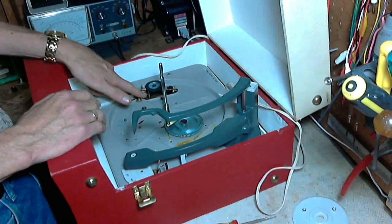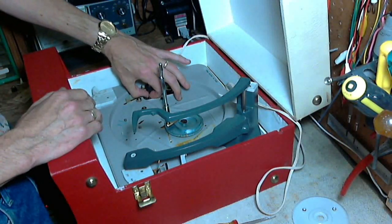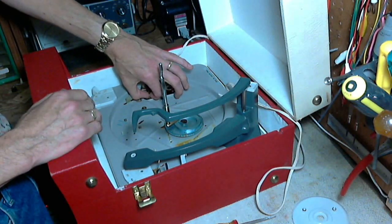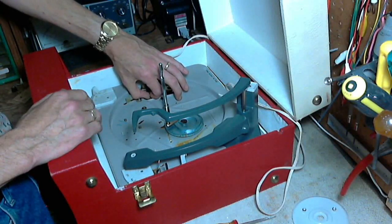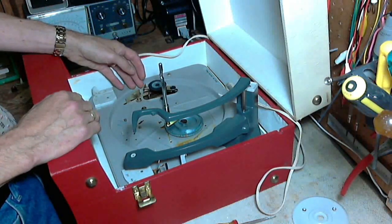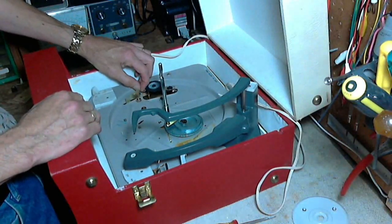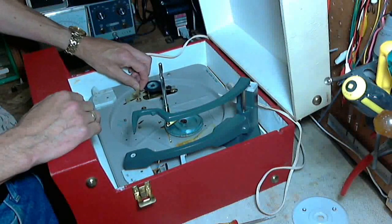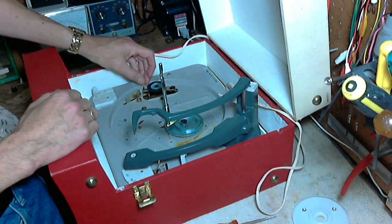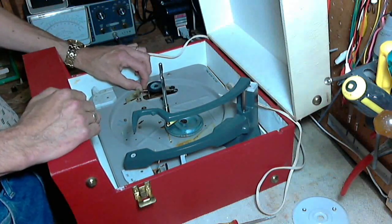I'm going to turn it back on and watch the motor, squeeze it a bit to slow it. You know what, it turns really nicely — it's not even worth testing, it turns really nicely. I don't think there's a problem there. This is the problem right here — there should be a spring pulling this. Maybe there is a spring but it's become very stuck. I can feel it loosening up, so we'll have to look underneath for the spring. I think the spring may be missing — it's definitely too sticky. This should move very, very freely.